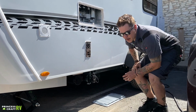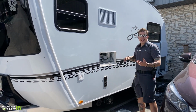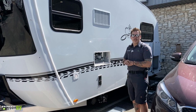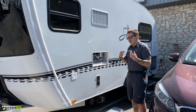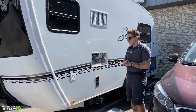And it is, again, very important that we do keep the mud daubers and flying insects from not only nesting within the furnace, but from all of the propane burning appliances. Those insects are attracted to the smell. It's not a matter of if, but when will they intrude these appliances.